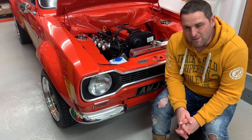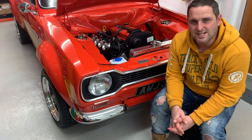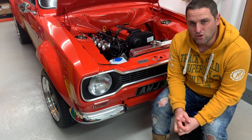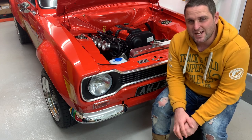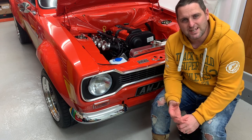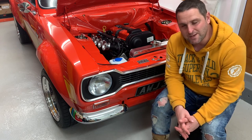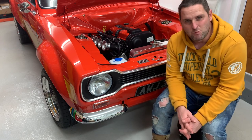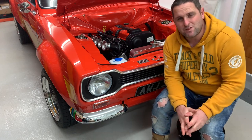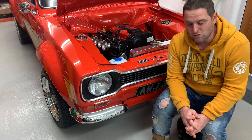And there was a bit of a metallic kind of sound, as I mentioned earlier, which we think is the starter motor engaging with the ring gear. For whatever reason, it made that noise to start with, I don't know. If you listen closely at the start of the startup video, when it fires into life, you can hear it kind of grinding, and then almost instantly it stops, and it didn't return after that. It started up multiple times after that without any issue. So I don't know what it was. I'll probably have to investigate further just to make sure that there's nothing major going on inside the bellhousing.